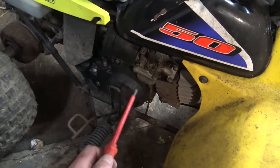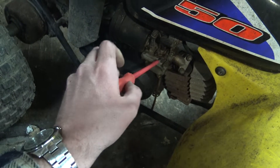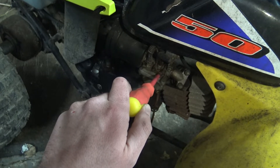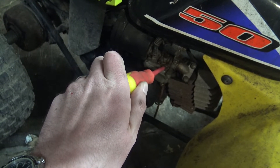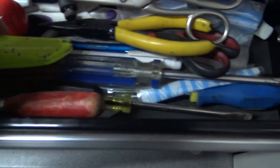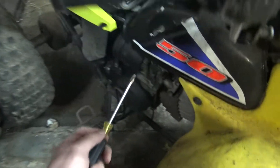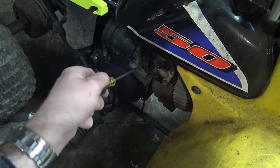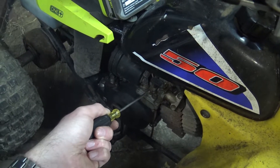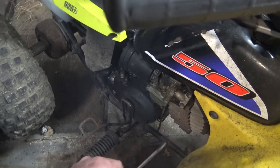It's running well — it's always been a good engine. I've put a little fan on there to blow the smoke out the door. I think the tick over could come down just a tad. One of these screws is the air mix, one is the fuel screw, and the other is the tick over — I can't remember which is which. That one's the fuel screw — let's get the right screwdriver. Yeah, I think the tick over is slowing down a little bit as it warms up after a couple of minutes.